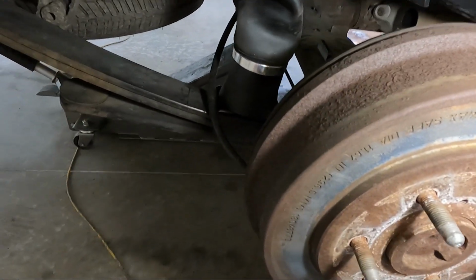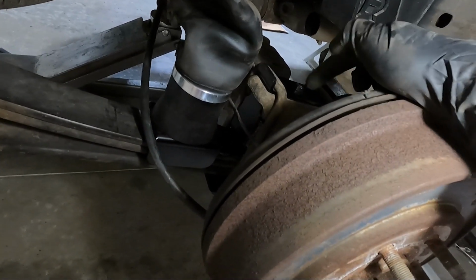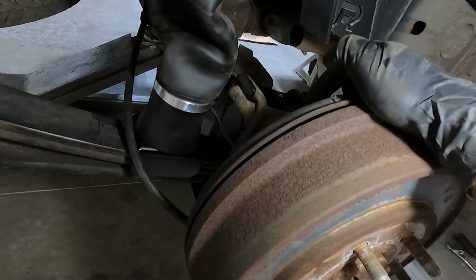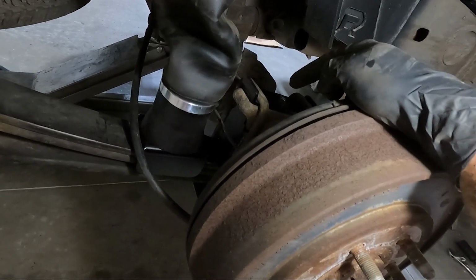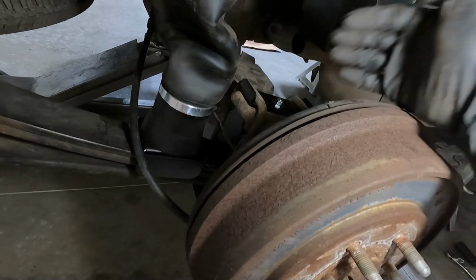In order to do that, you do have to take that center pin out, basically what we slid the saddle over. When I did that, I reversed it. So the threads are pointing down. And the reason I did that, for a couple reasons. One, obviously the U-bolts weren't long enough. Nothing was lining up with that shim in place, even on the bottom.